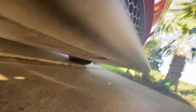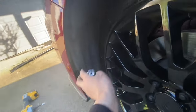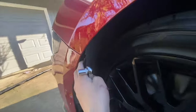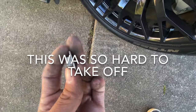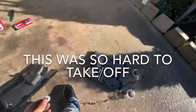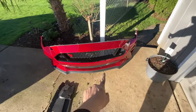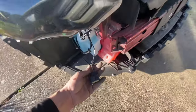There are also two bolts right here — push this to the side and you'll see them. Take those off — it's a washer and a bolt, and there's another one in there too. Make sure you don't lose those. After that you should just be able to pull the bumper out.